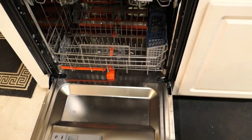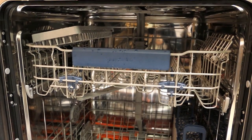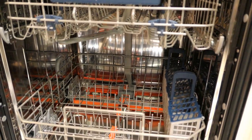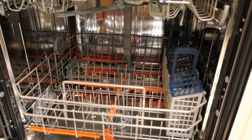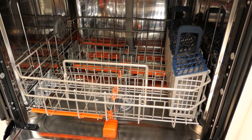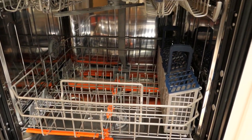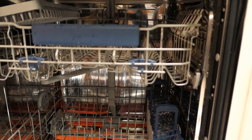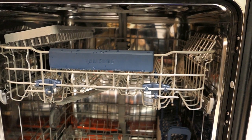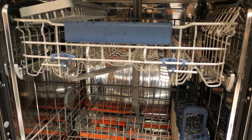When you look inside, you'll see this dishwasher uses a stainless steel tub. There are two major types of tubs in dishwashers: stainless steel and plastic. The advantages of stainless steel include less noise, as the heavy steel walls absorb most of the noise from the cleaning process. It's also more energy efficient, since steel absorbs more heat than plastic and needs less power during drying. Additionally, it sustains temperatures over 160 degrees Fahrenheit, leading to cleaner, better-sanitized dishes, and the thick walls are more durable and less prone to cracking.